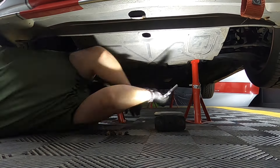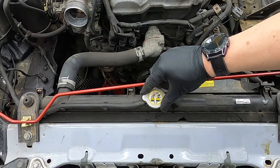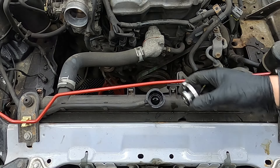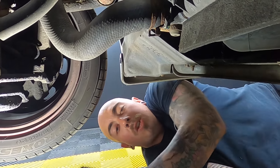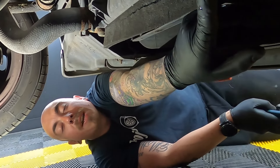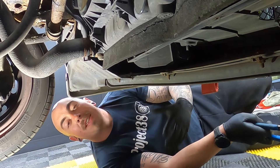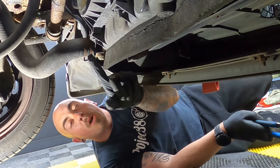Now the car's jacked up, the next thing to do is drain the cooling system. Make sure the coolant isn't hot while you're doing this as it can pressurise and go everywhere and potentially burn yourself. Remove your under tray — there should be three bolts at the front attaching to the bumper, two bolts at the back attaching it to the subframe, and two bolts up either arch.